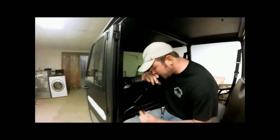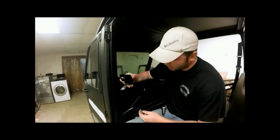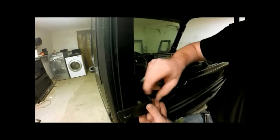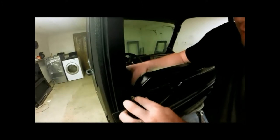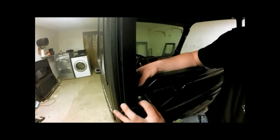Okay, we'll now take our striker plate. It comes in our 575X box, and we'll actually bolt through those slotted holes. We'll install it just like that with our slots here on our piece coming back out towards the outside of our bike. Go ahead and nut the back side here. We'll bolt the top now. Now notice how our slots here, we have room for adjustment. Just keep that in mind for any later adjustments you may need to make on your door for proper fit.